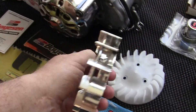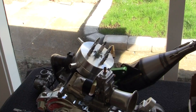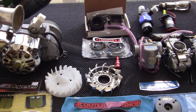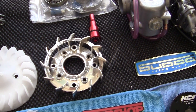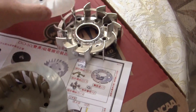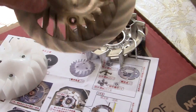You can use this fan or the stock Honda fan on your bike - and I'll tell you what will happen if you're lucky. I had a red fan on my bike, I thought it was cool, dress-up. Put it on, revved it up - all of a sudden, bang. It exploded. The only thing left was little pieces of red bolted onto the flywheel. These pieces of crap are not balanced. All they are is flying shrapnel. Honda spent millions of dollars getting these fans correct. Have you ever heard of one of these going bad? No. It is a nice fan, and Honda developed them pretty well.